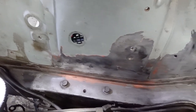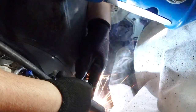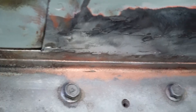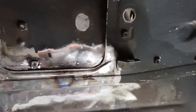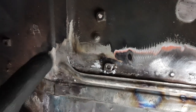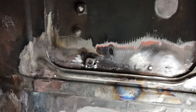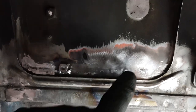So before I get some primer onto this, I just want to show you what it looks like in bare metal. That was actually really hard to weld — I had much less room than I thought I was going to have when I was looking at it without my hands and a welding rod in the bay. But overall it's come up pretty good. There was a lot of top weld to grind down, but I did get reasonable penetration and have filled all the gaps. From the inside of the strut tower, it's much the same story — just a little less neat around things like this nut. I can probably get a Dremel in and tidy that out a little bit later. But what I am going to do now: we still have this large gap, and obviously I don't want to leave that there or it's just going to have the same problem as it did last time. So I'm just going to get a block of wood and put some pressure on this piece from the inside of the bay, and then put some tacks on top here to keep these two pieces of metal together.